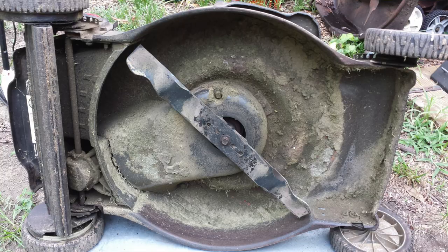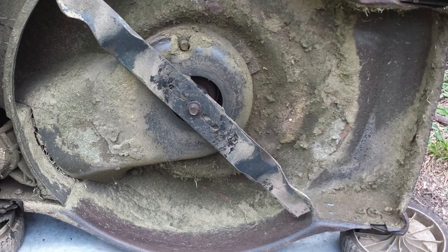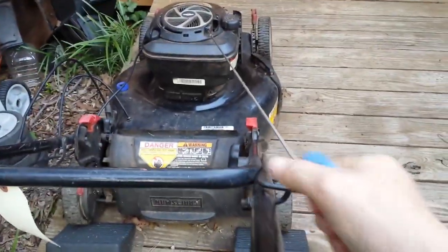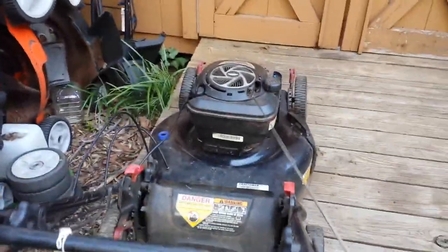The guy that brought it to me — I suspected that he hit something, and he said he did because when I turned the mower over the blade was on upside down, and of course he mows at the lowest possible setting, so the blade has been hitting all kinds of things. The biggest clue to me, other than it not starting, is that it would tend to jerk the pull cord right out of my hand about every third or fourth time I tried to pull on the cord. Some mowers do this very violently, and this one wasn't so bad, but it was enough to make me suspect that this is what the problem was. So let's get into this and see if we can figure this out.